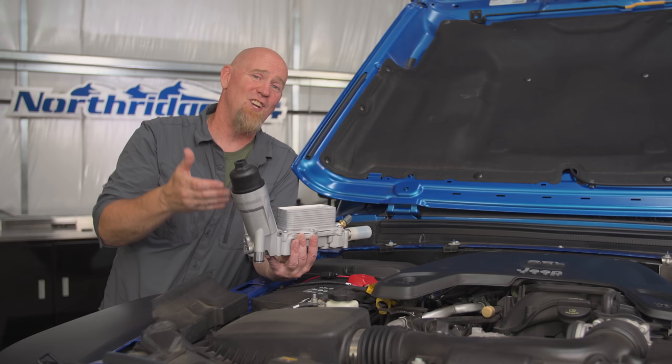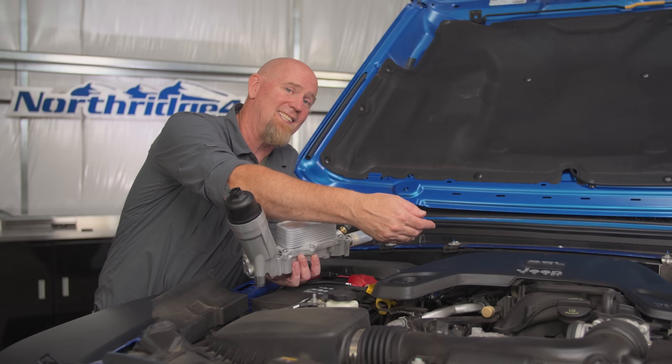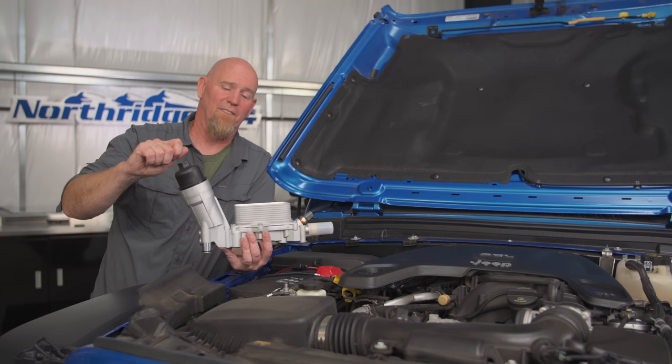You may recognize this part here. This is your oil filter cap and you're going to unscrew this to pull your filter out to change it. Then we have our oil filter bowl and that goes back into our oil cooler. This whole assembly rides down in the valley of the V6 and it's underneath your intake manifold, so you don't really see a lot of it. And as mentioned, there is no oil drain back valve keeping this whole assembly and the areas up above on the engine filled with oil.